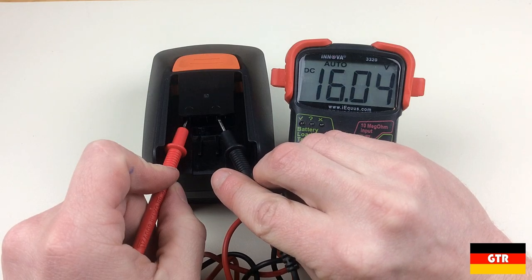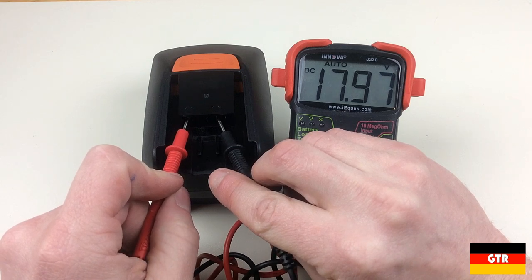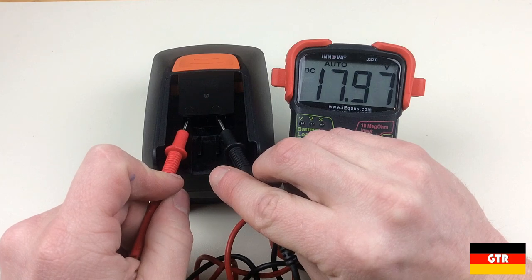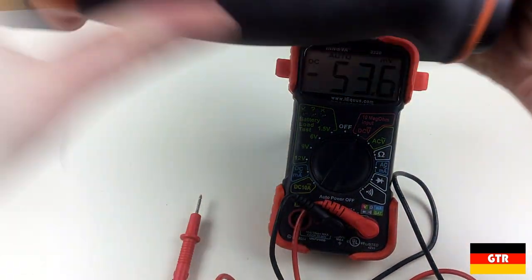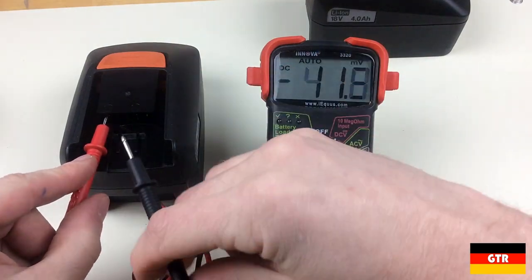Using a meter we can look at the voltages from the two batteries. The one that is almost dead is putting out around 17.9 volts. The 18-volt value is the nominal voltage for the battery, so I would guess this battery is closer to 50% capacity — meaning their fuel gauges must be very conservative about telling you when to swap it out.